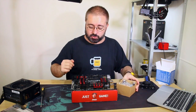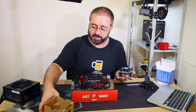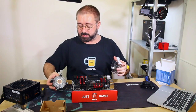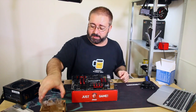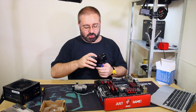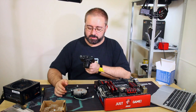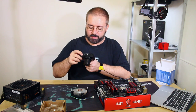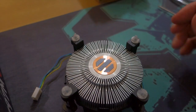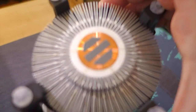Next up is the CPU cooler. Do not start up the machine without a cooler attached, even for just a power-on self-test, because these things can heat up rather dramatically and quickly. I'm using the stock cooler to start with. Back in the day, stock coolers used to be kind of terrible - noisy, rattly, horrible things. But apparently the Intel stock coolers these days are fairly decent. Those grey pads on the back are pre-applied thermal compound.